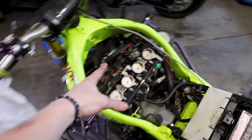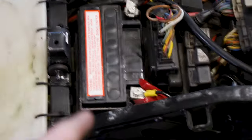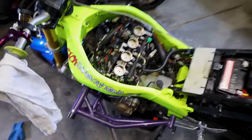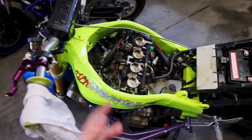Spark plugs are all nice and fresh, and our air filter is nice and clean. What we're going to do now is clean out that coolant and finish the whole flushing process. Then we'll throw oil in the bike, and I'm also going to charge the battery to make sure that thing's full. It should be running pretty clean — just a quick, easy service on the engine to make sure there are no little things that could cause a bigger problem. The bike did have a little bit of trouble starting yesterday before I drained the oil, but I think it should be running a lot better.